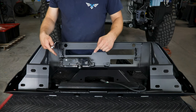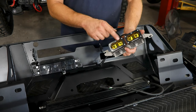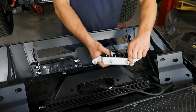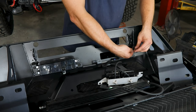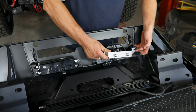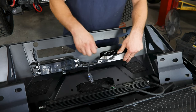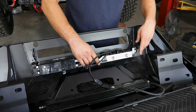You can center those up from the front side and then grab a 5/32" hex and tighten them up. For the Baja Designs kit, go ahead and follow their instructions to get it put together — one of their holes is slotted and that's going to go toward the outside of the bumper. Since it's slotted, we can loosely install one of those bolts and nuts out here — these are the same quarter-20s you'd use with the factory light. Then you can slide that slot onto there and install the remaining bolt and nut in here to secure it in place. Get your wires out of the way, and then from the front side you can center these and tighten them with your 5/32" hex.